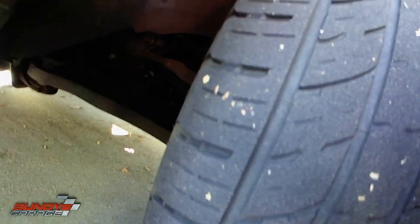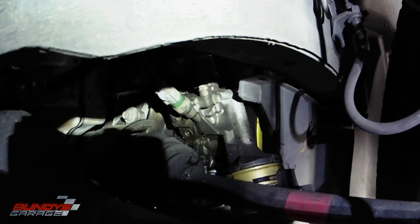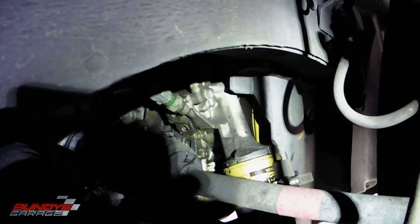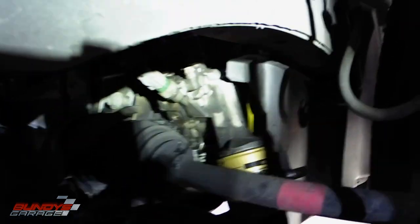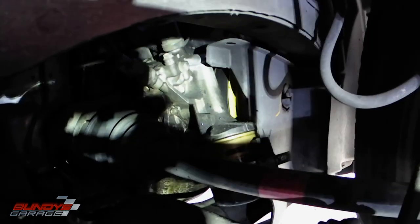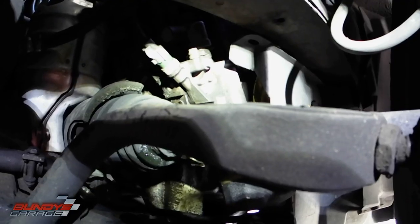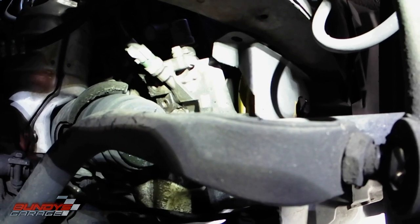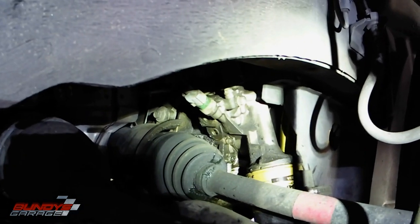Working on the passenger side, going below behind the tire, let me show you one leak point that is pretty common. Right there you have the oil pressure sensor, you have a VTEC solenoid gasket, and you have your oil filter down there — but that leaks after a while. This vehicle has 206,000 miles on it, so it's starting to leak. You'll see oil pooling up underneath it if it's leaking really bad. I'll put links in the description below — I have a video on how to repair that leak. Pretty easy, you should do it when you do the oil change.